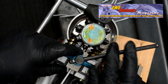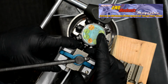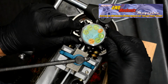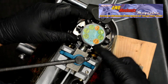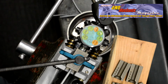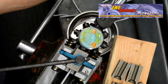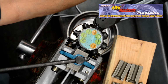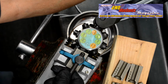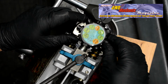As a first step before flaring, run the screw down lightly. At this point, rotate the turret to operation 0, which is the flat punch that will align the tube and square the die set with the fixture. The tube end should be square with the die set and flush with the face of the dies. Now the arch clamp can be securely tightened. This will assure that the tube does not press through the dies during the flaring process.